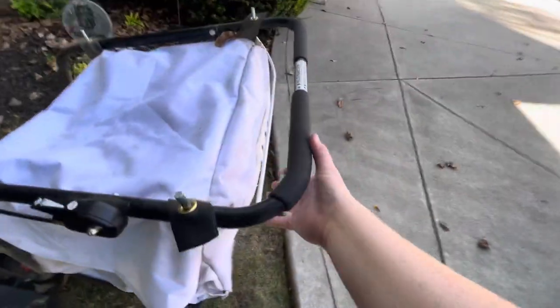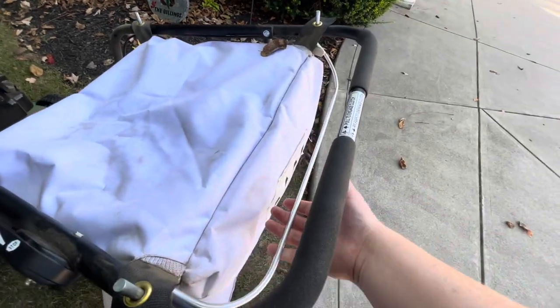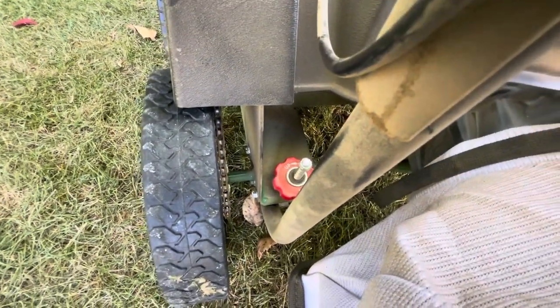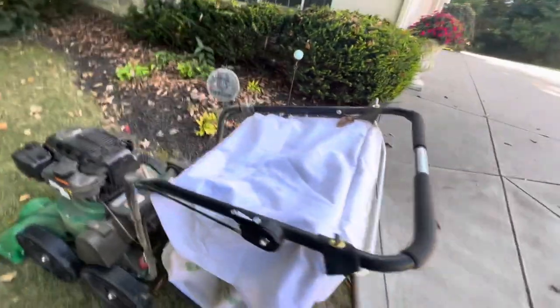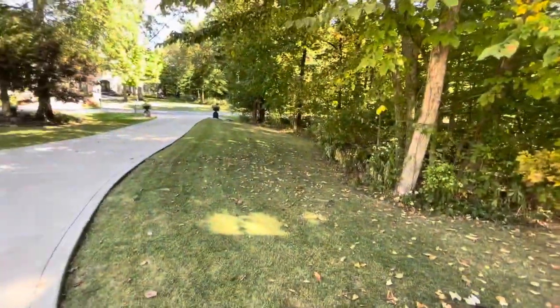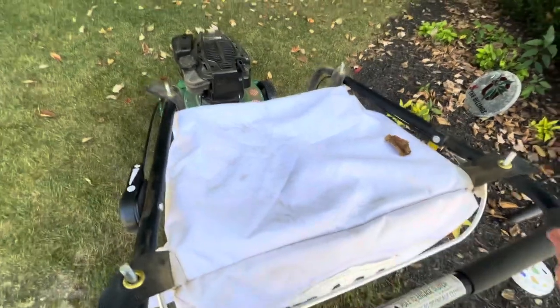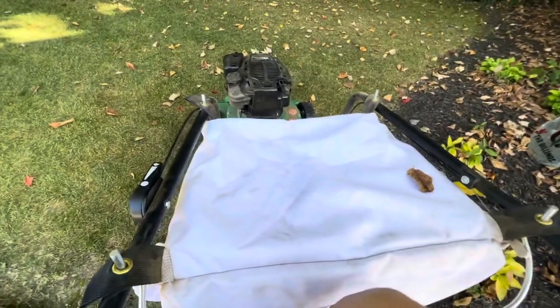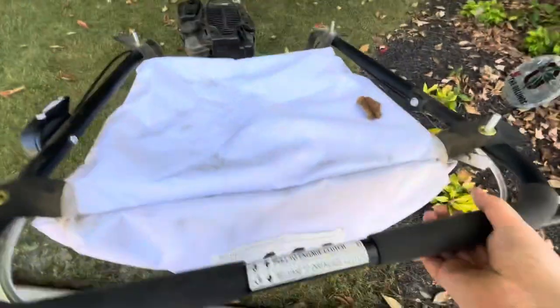This right here is the self-propel clutch. In order to engage the drive clutch, all you need to do is pull on this bar, and there is a chain and sprocket going to each of the back wheels, with the chain hooked up to a pulley on the engine. Something I've learned using this machine: because this area is pretty hilly — I know it doesn't look that way on camera — when I pull on this all the way suddenly, it kind of bogs the engine a little. It doesn't shut it off, but it struggles. So what I do is pull on it slightly until the engine knows I want to use the drive clutch, then go all the way back with force on it.